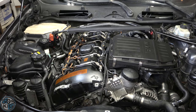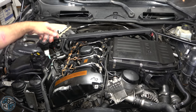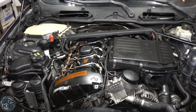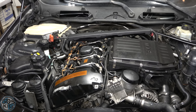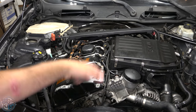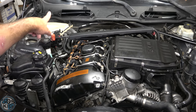You can definitely still hear clicking and clacking, and it's not running perfectly smooth — I think that's down to the fuel injectors, which we'll be changing very soon. I cleared the engine adaptations with my scan tool and it seems to be idling a little bit better. Some oil is burning off the exhaust from when I took the valve cover off. I'm going to let it keep warming up, then go for a drive at speed with my foot on the gas for a while to get the lifters to pump up. They're already sounding a little bit quieter.